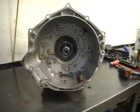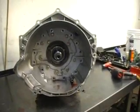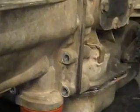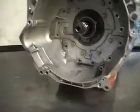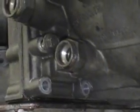I have already removed all the outer bolts to remove the bell housing — the pump is part of the bell housing. You have some bolts right here, another one there, and on the opposite side as well. There's still one bolt in there because the cooler line fitting is interfering, but it's already loose so we can just pull this bell housing off.